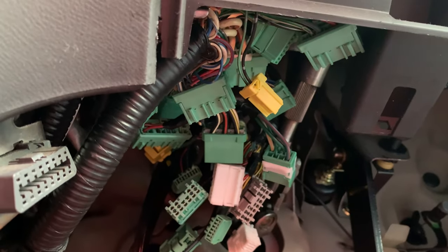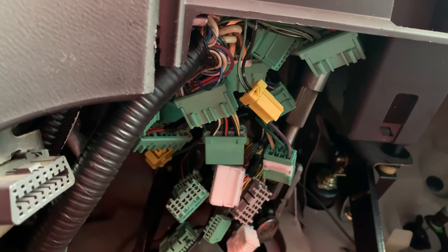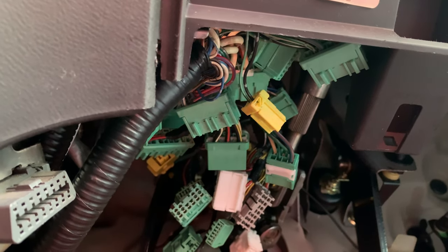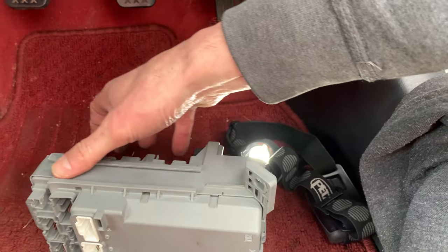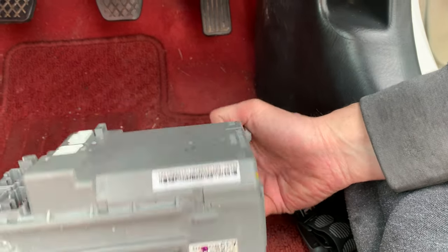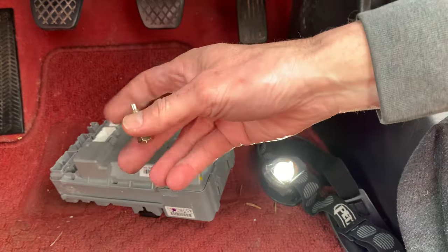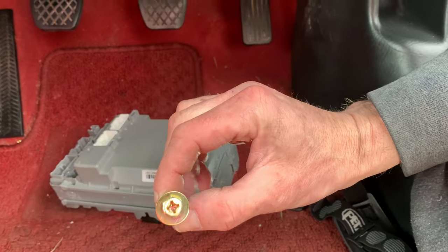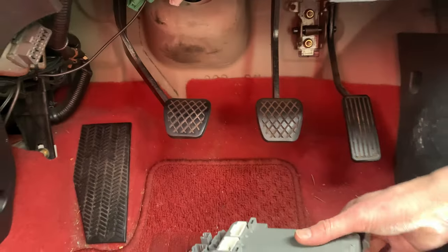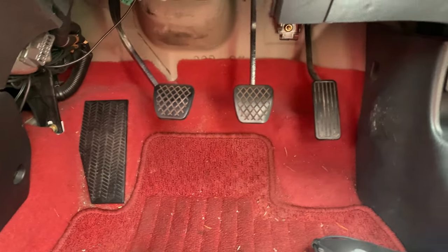The new one comes pre-loaded with a bunch of fuses so it should just be plug and play. You've got a whole big nest of wires and plugs hanging out back here — quite a bunch of them. What I'm going to do is plug them all in and then reconnect the negative battery cable, and then see if my issues are taken care of before I physically bolt it back in. This unit is actually designed to slide on a rail system — there's a rail on each side — and there's only one bolt on each side, a 10mm right down at the bottom.